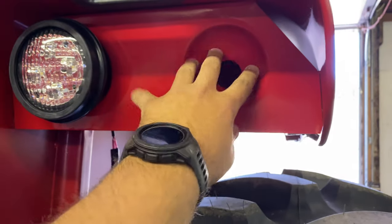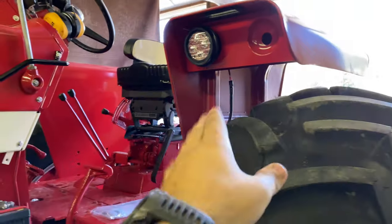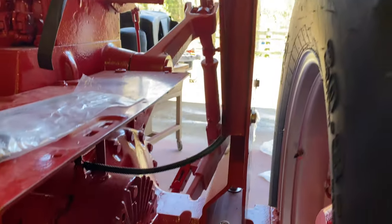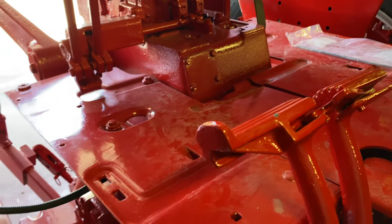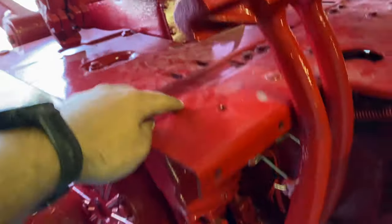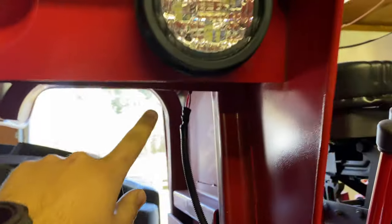I went ahead and put the fender lights on — here's a quick runthrough of how that works. There's a stud through the headlight with a nut, and I just ran a big washer — they don't come with those. There's a flat spot on the back of these holes, so they push up against that, and when you put a washer on, it flattens up against it. There's a red and a black wire — they both run across that side, then come through and take a turn to meet up with the other wires. This side does the same, going down and meeting on that same line.